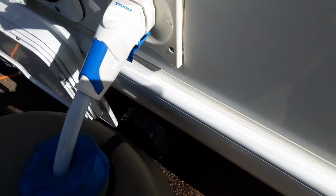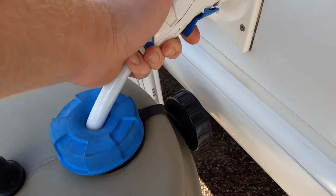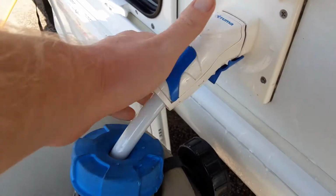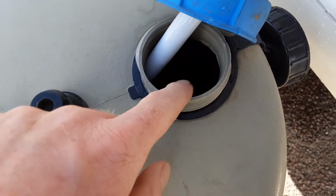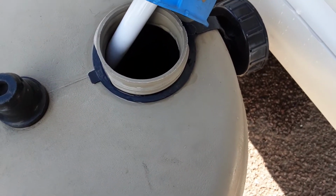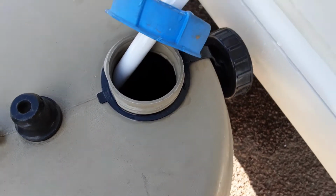You then got your water pump connection: blue trigger back, pull the pump out to release it from the van and push in to lock it in place, and then let the blue trigger go again. You need to make sure the Aquaroll is completely full prior to turning on the water pump, because if you don't, it will draw air up inside the van and cause an airlock in the water system.